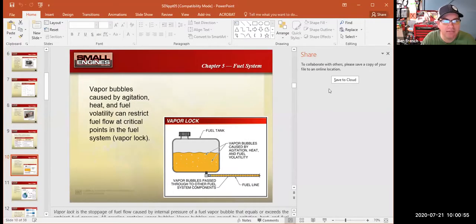Well, on cars, as we switched over throughout the 80s and 90s, cars became electronically fuel injected. They still have an EVAP system, but they were able to put fewer emission control components on cars because they got better control of the fuel. So for many years, cars got rid of having an air injection system, for example, because they didn't need it, since they had so much better control of the fuel by being electronically fuel injected.